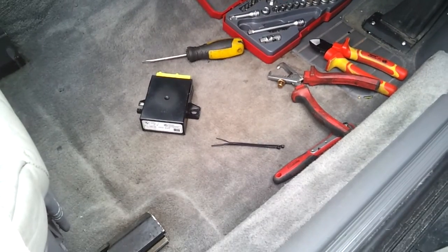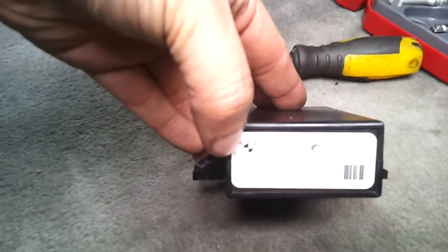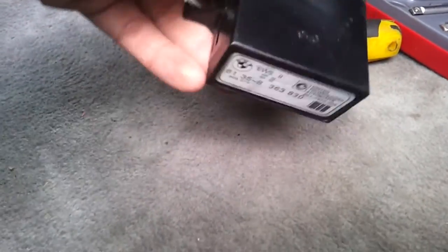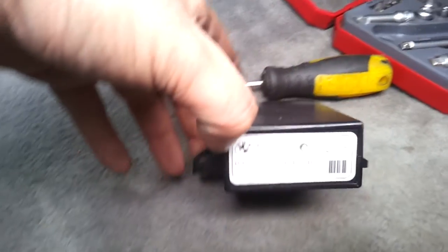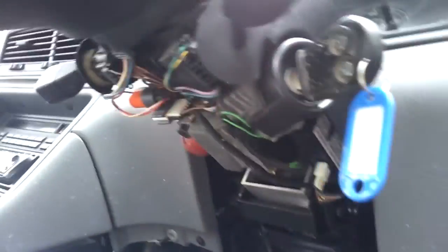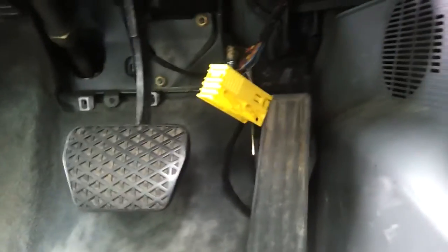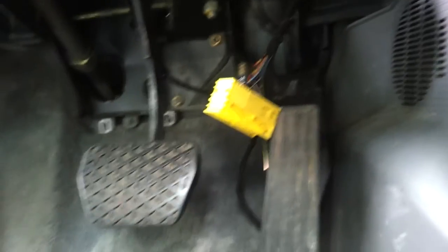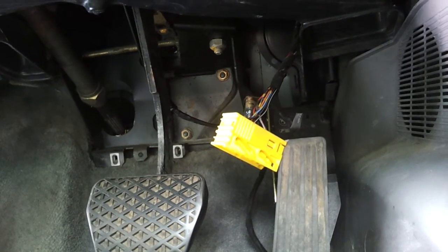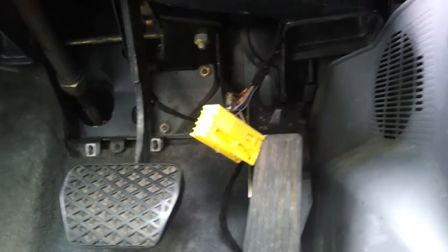I had to get under the dash again. This piece of kit is the EWS module — the anti-theft system. I'm guessing it got concerned when somebody stole the V8, and it was inhibiting my start signal from getting from the ignition key into my power distribution block. I had to contort myself under the dash, unplug it, figure out where the signal was being blocked, cut the cables, soldered them together, and now we've got a start signal at our power distribution block. The joys of conversion.